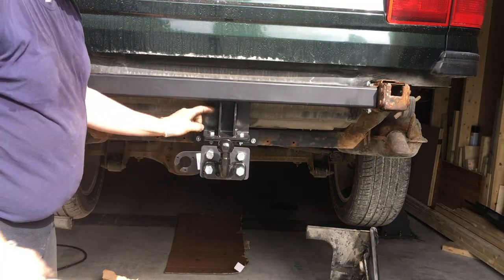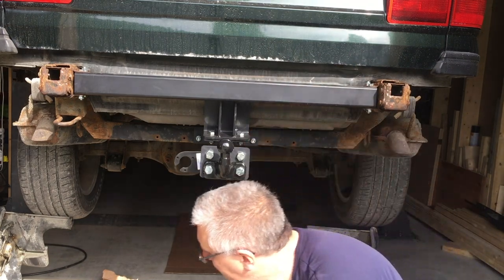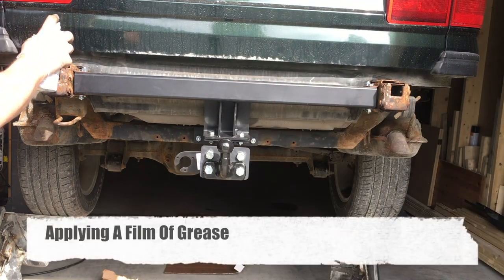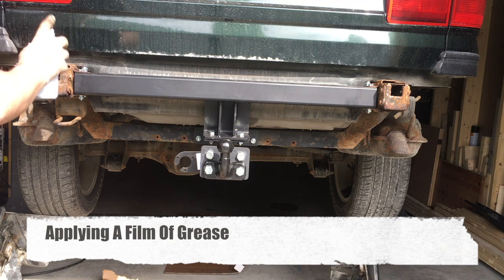Torque values: 24, 22, 17, 17. It's never going to be taken off, but I'll try and rust-proof it a little bit anyway.